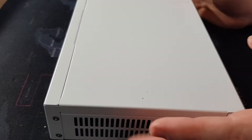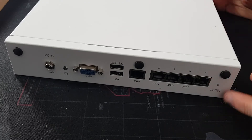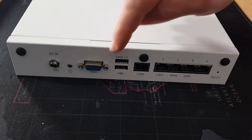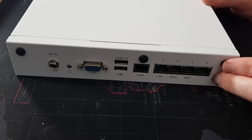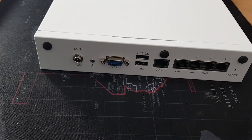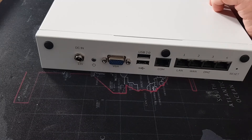The XG105 is one of the smallest Sophos firewalls. Below this there was the XG85, and the 86 is the current version. I would suggest avoiding them and find a 105, as the XG85 does not have any form of video out, so it does make them a bit awkward to load and they're a lot more restricted. The XG105s are going to start coming up, but this is only officially supported up to version 17.5 by Sophos. So if you're running version 18 on one of these, you should not do it in production because it is not supported.